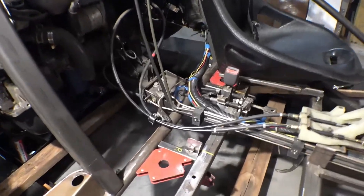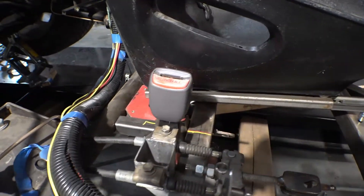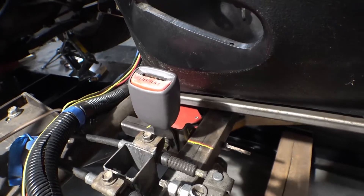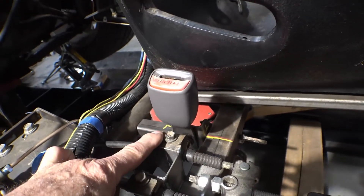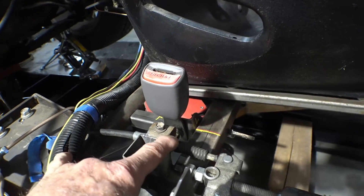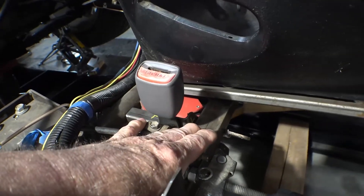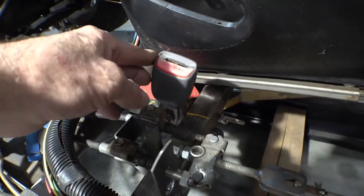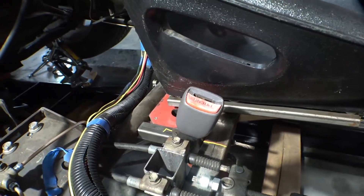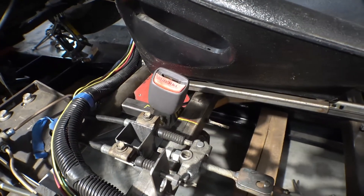After a bit of cutting and shaping of metal parts, I have these temporarily clamped in place so I can tack weld them. The seat belt is just barely going to clear this. I may cut these brackets off and turn them upside down — that will lower it and give me a little more room to put my tunnel over the top. But the seat belt will pivot forward as the seat goes forward, it clears everything, it'll lock in place. Once all that's welded together that should provide a pretty solid mount.